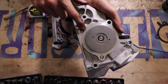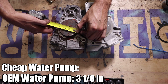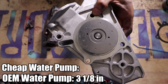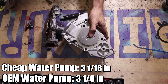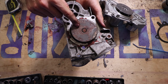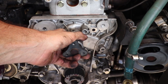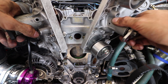Not to mention, when you measure these up next to each other, this one measures in at three and an eighth of an inch, and this one — which is off center, you can see the ring is not even centered — measures at three and one sixteenths. So this is a sixteenth of an inch off from the OEM, which means it's going to fit much tighter. I'm going to put these on the car and show you what I mean. The aftermarket has a lot of play, whereas the OEM — that's it, that's all there is. Definitely stick with the OEM and not this shitty aftermarket.